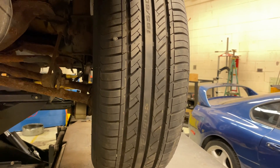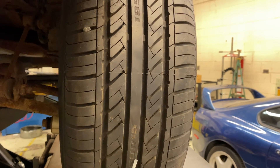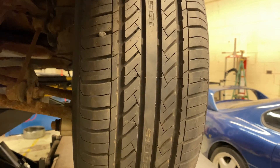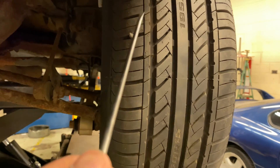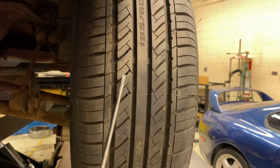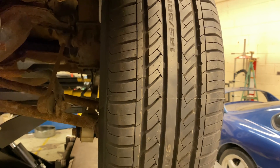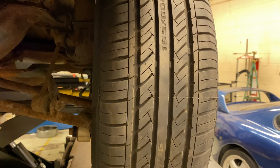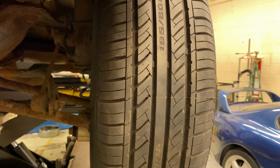Here is another example of a symmetrical tire. As you can see, besides this marking which is just a fancy thing the manufacturer put to show you the tire size, if you look at both sides you have the same pattern. One of the most convenient things about a symmetrical tire is the fact that you can mount it onto the wheel either way — it doesn't matter, it doesn't make a difference. You can't really mess up. That's one advantage of a symmetrical tire.